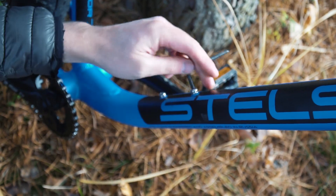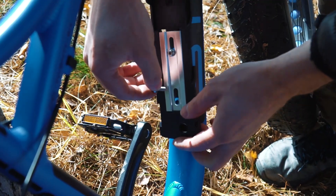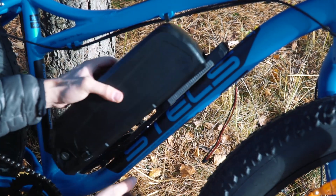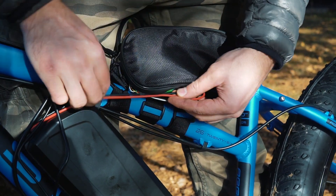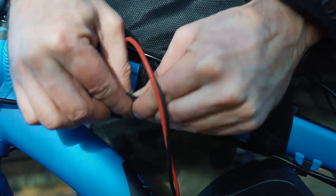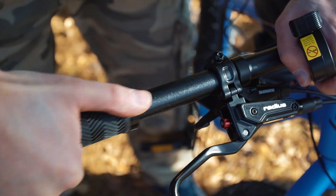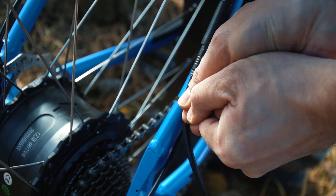The next step — let's install the battery. There is a bracing for a flask on the frame; we should fasten the platform for the battery here. We need to attach the platform in a certain position on the frame to get enough space for the battery. It's all done. Now let's connect it with the controller. We attach the controller at the top of the frame — it is the most suitable place for it. Then we should connect the motor wheel to the controller. After that we attach the computer to the left of the handlebar, and the throttle at the right of it. And the final thing — the wiring: put the cables neatly along the frame.